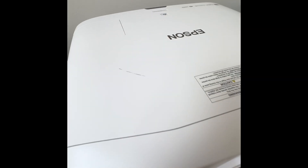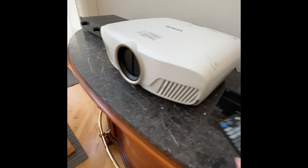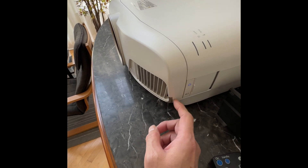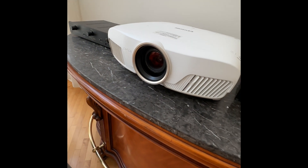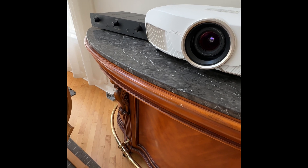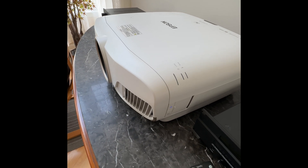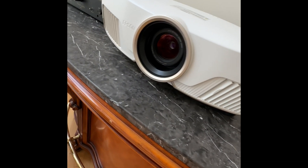Okay, I need to put my power cable back on. Let's plug it in and give it a try. The power light means the cable is connected — let's cross fingers. The blue light blinking means it's turning on, and the lens window opens up. You can see the light coming out — that's good! Originally when the lamp was bad, there was no light and the projector would stop automatically, close the lens door, make very loud fan noise, and the orange lamp light would turn on. Now I think we are in normal operation.